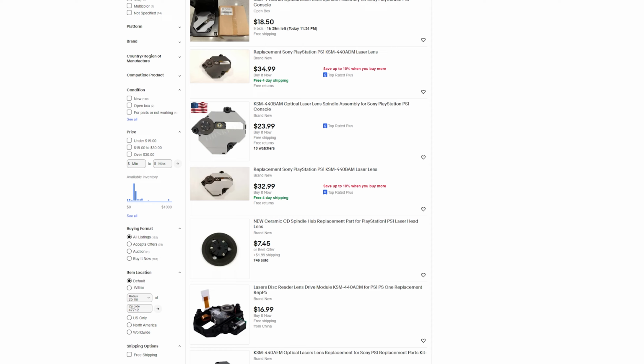And today we're going to be taking a look back at the PlayStation system that we messed around with last time. This is the same one that I bought off eBay for about $20. Seller said the disk drive or the laser no longer worked. So we took this guy apart completely. We cleaned up all the grime with toothbrushes, isopropyl alcohol, Q-tips, everything that we needed to make this a pristine system. And at the end of the day, all we needed to do was clean the laser itself with some isopropyl alcohol and a Q-tip, and it ended up reading the disc, which was awesome.